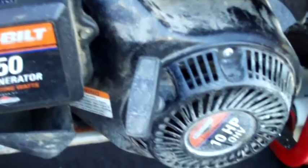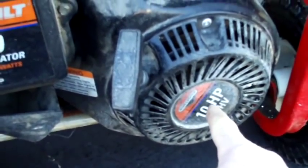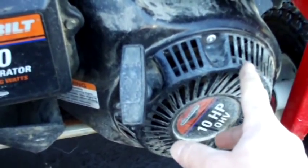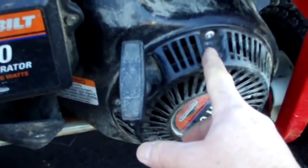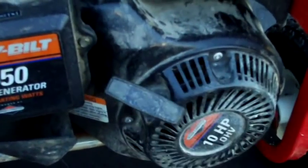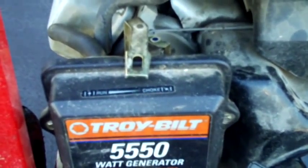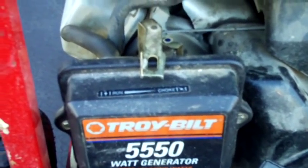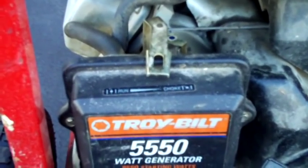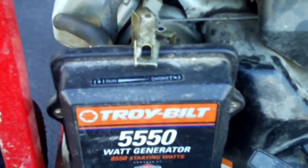I went ahead and remounted the recoil on this. It's supposed to be at the 2 o'clock position but that made it hard to start. So I re-drilled these out and put it at the 10 o'clock. Being right-handed, it's easier to pull start it that way. The carburetor still needs to be cleaned a little bit — it'll run about three quarters open, not exactly wide open, but one click from wide open it runs.